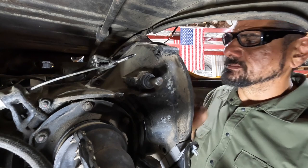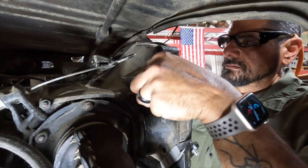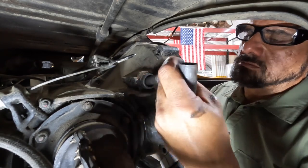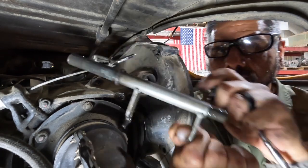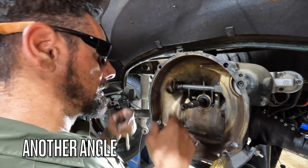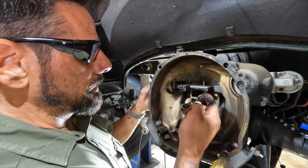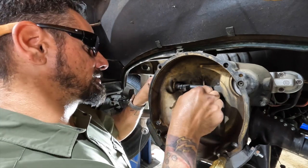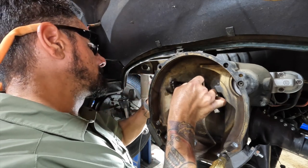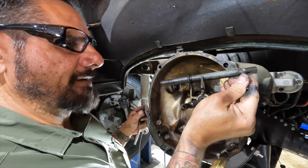We'll go look at these further from the table and get everything out of here. Shaft is out, our indexing screw is removed, our throwout arm off the shaft is removed. Everything's taken off that side. We're going to pick it up to where these are above the input shaft of the transmission, slide it over, pull the bushing and everything off of it on this end - and that gives it just enough play to where it comes out of there. That's our shaft coming out.